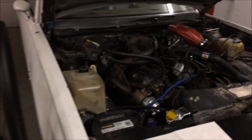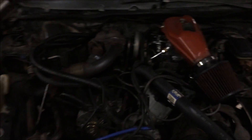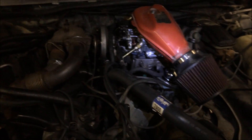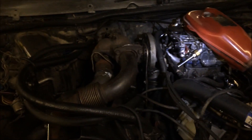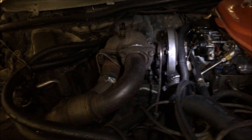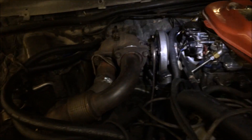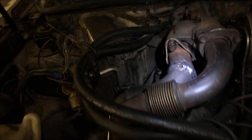Here's the 1980 Turbo Buick. We've done a lot of work to it since the last video. I finally got everything fabricated. Did a different air filter route right there, right on top of the Summit 4-barrel double pumper carburetor. And it draws through into the Garrett AR60 Turbo — the original turbo found on the 87 Buick Grand Nationals. I fabricated it to fit this 1980 draw-through setup.